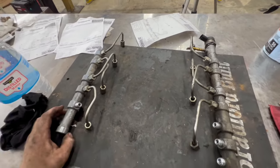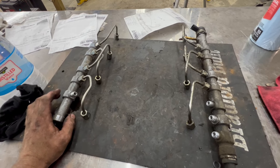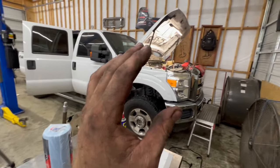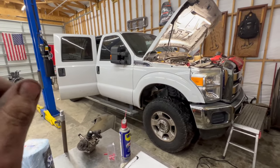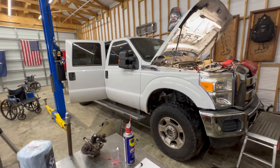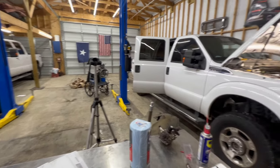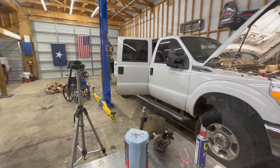So there you have both of your logs. It's late — I'm probably going to wrap this up for tonight and pick up in the morning with pulling the injectors out. Then we'll start throwing stuff back together, get everything done on the motor. The next thing will be flushing the lines, dropping the tank, cleaning the tank, changing the fuel conditioner, changing the lift pump. After we get all this together, we'll move it over to the lift bay with the Rhino and flush all the lines.